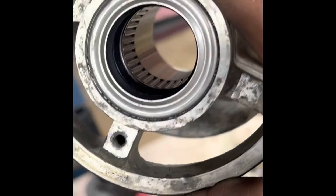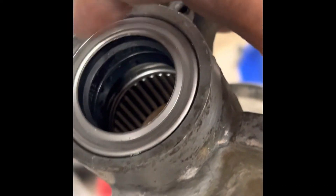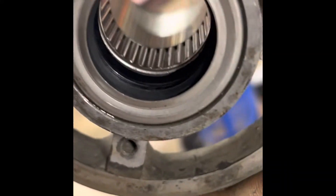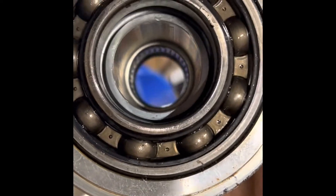The next thing we're going to do is set the carrier. I'm going to show you the carrier - the carrier's already had everything changed on it. If you look at the carrier right here, here's your new seal. You've got an inner and outer seal - supposedly the seal cuts fishing line. I also reset a new bearing inside of there. The bearing on the outside was still in excellent shape, no point in messing with that. So that's going to be the next thing we set in - that'll be my next video on how to put this together.